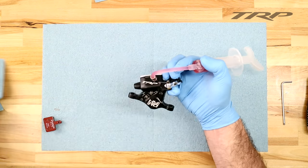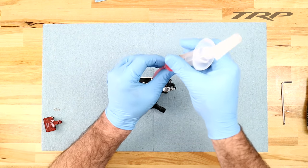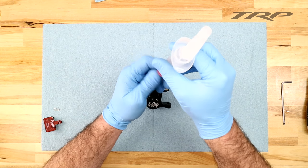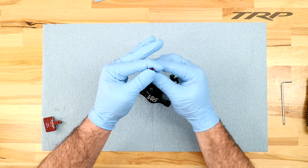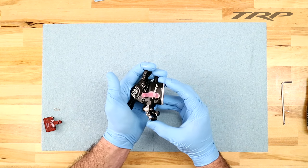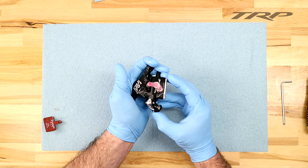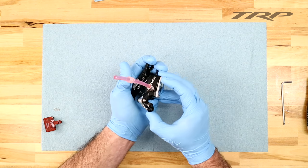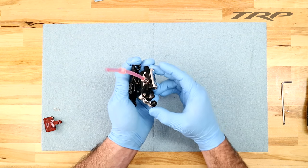The reason for this is what we can do now is what we call a lever purge. Start by removing the actual syringe itself from the surgical tubing still attached to the reservoir. This will give us some excess fluid to top off the reservoir system as we perform our lever purge. The lever purge is performed by slowly pushing the actuation arm and trying to encourage any bubbles that might be trapped in the reservoir to come out through this tube. In turn, the fluid in the tube is going to flow down and top the reservoir off.